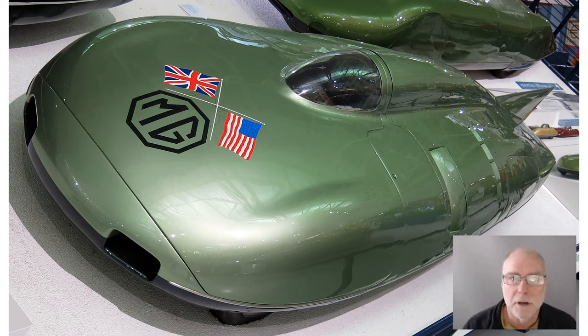Wow, this is what it looked like when I photographed it in a museum in the UK — an extraordinarily advanced looking car. It looks like a solar race car of 20, 30, or even 40 years later. Amazingly low drag shape. Here are the coolant inlets at the front in the stagnation zone, beautifully positioned. Here are the coolant outlets, the air outlets for the cooling system. And here are the exhaust outlets. All of them are aimed along the skin of the vehicle.